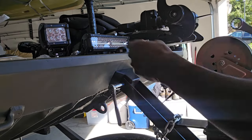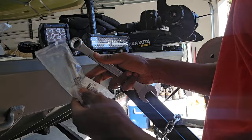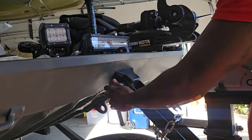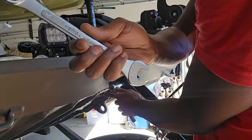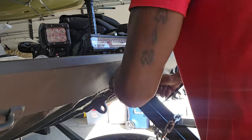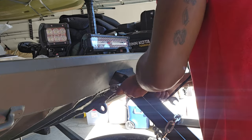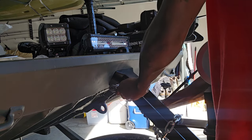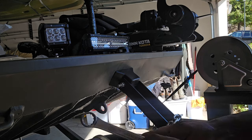I had to run out and get a shorter bolt — had to go with half-inch but five inches instead of six inches, since six was a little too long. I had to grab a deep socket to get it back on the right way. You need a three-quarter inch wrench and socket to get it back on, but you need a half-inch bolt to go through this Yates bow stop. I still don't like how far that's hanging out, but it's much less than before — so I'll accept it. Looks nice.